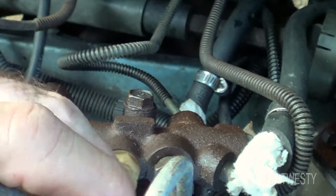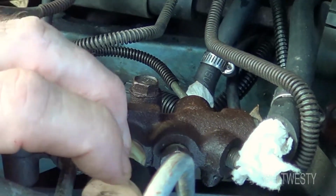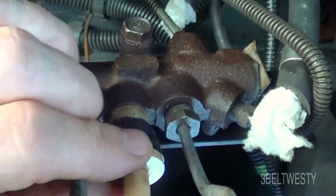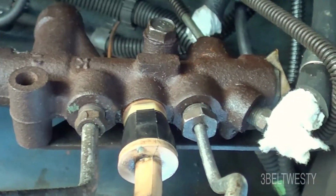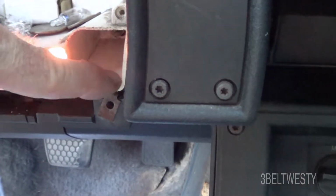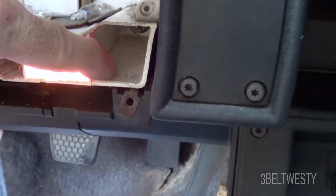I'm going to go ahead and pop this on here. I put the valve back in. I actually recentered this by bleeding the back brakes. I'm going to go ahead and push this on. It'll click in place. To get this off, you have to squeeze it this way, but we're going to see if the light is on or off now. So over here, this is off. Of course, I've got the dash up. Normally it'll say brake. I've been doing some repair work, replacing some bulbs, but I've penciled in the word brake there. So that's about it.